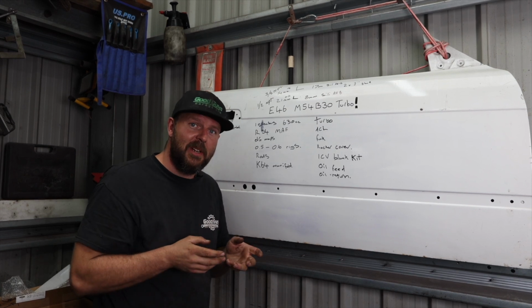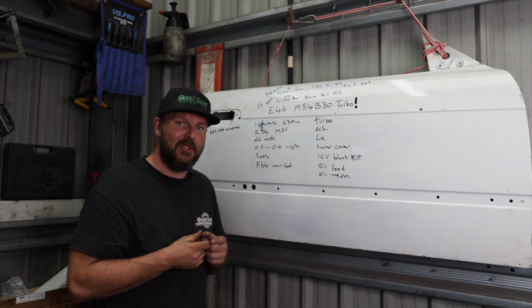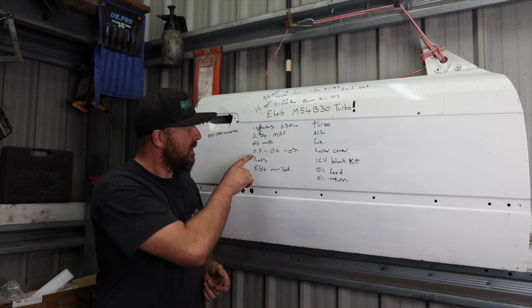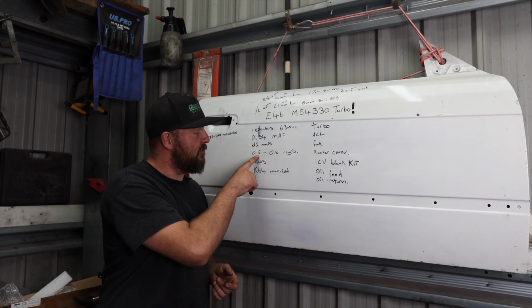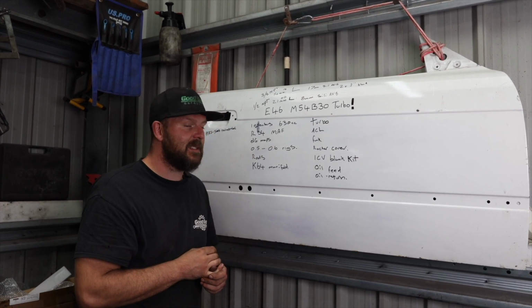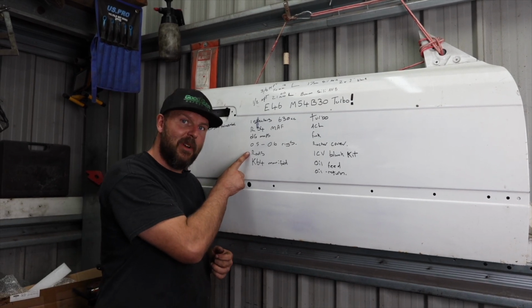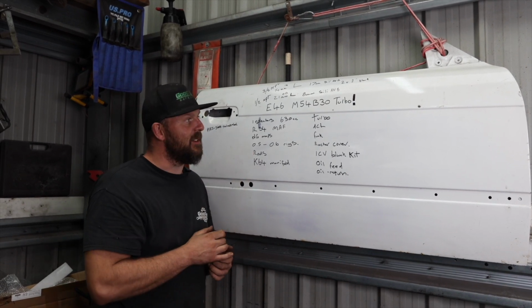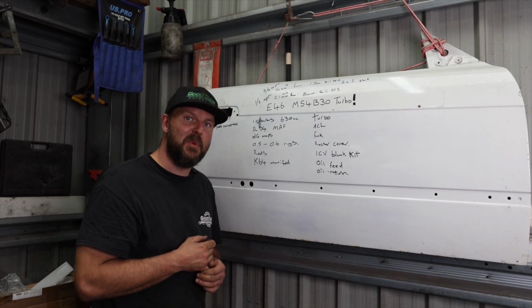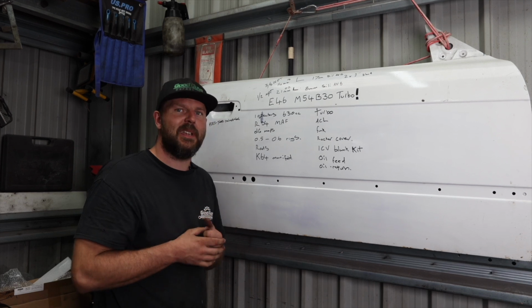Because when you turbo a car, you need to allow for more heat, so the piston ring gaps need enlarging. You will have seen this on the episode. So we've gone for the first ring, 0.5, and the second ring is 0.6. That's of a millimetre. Obviously you've seen we've upgraded the rods. That is because we've got more air. More air equals more bang, more power. But to account for that, we need more stronger connecting rods.